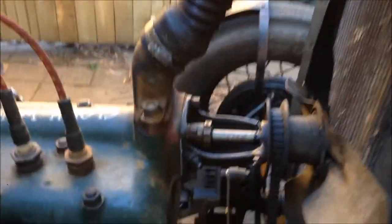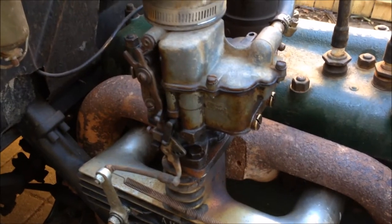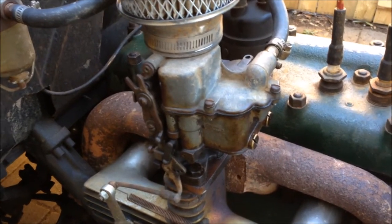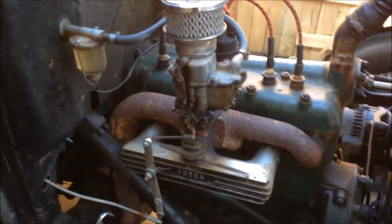I had to rebuild the water pump — it was leaking. Also rebuilt the carburetor with new jets and an accelerator pump, and jetted it right. So that's been done.